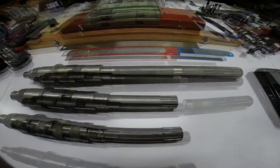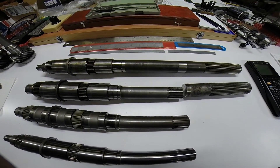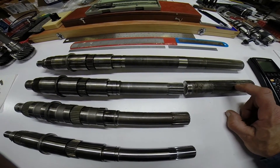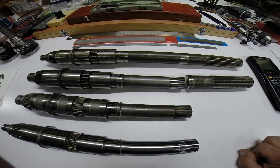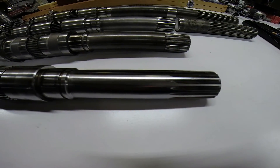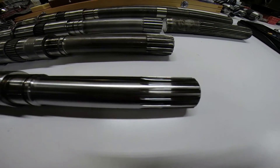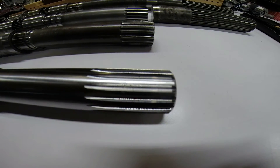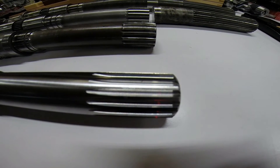Here's the fix. You would cut the Saginaw main shaft — this is the section that has been removed so that the shaft is now shortened. Then, because of the diameter and the material available, you would turn the diameter of the original main shaft to 1 inch 55 thousandths, and then cut the new spline to match the Corvair pinion gear into the original Saginaw main shaft.